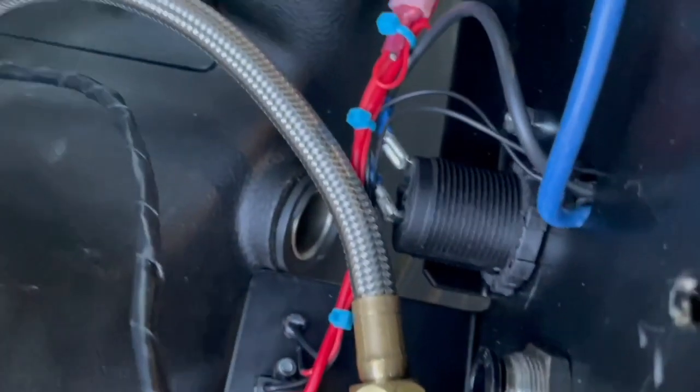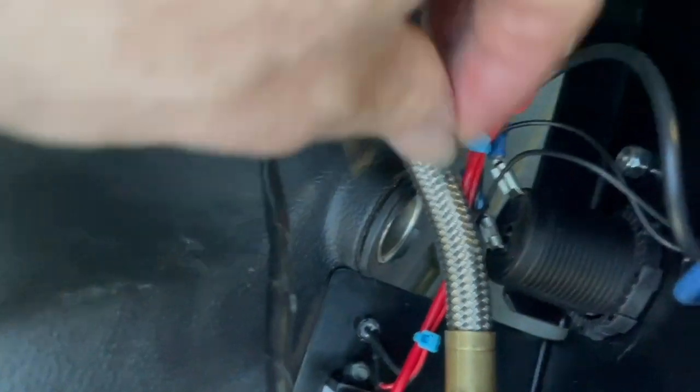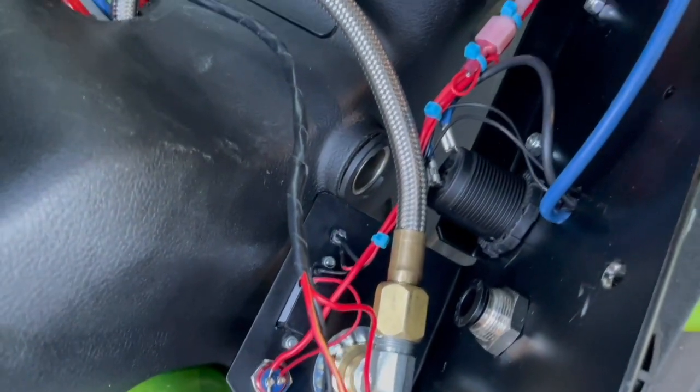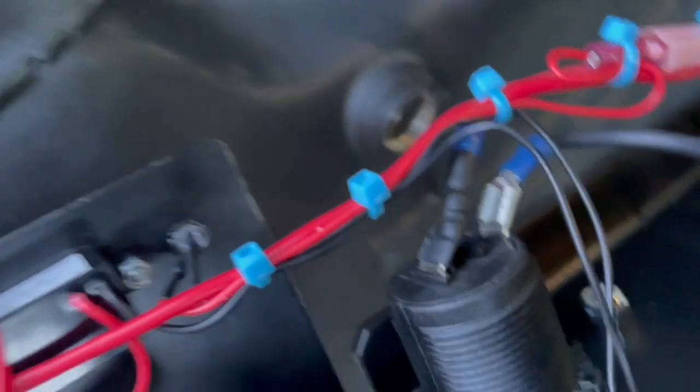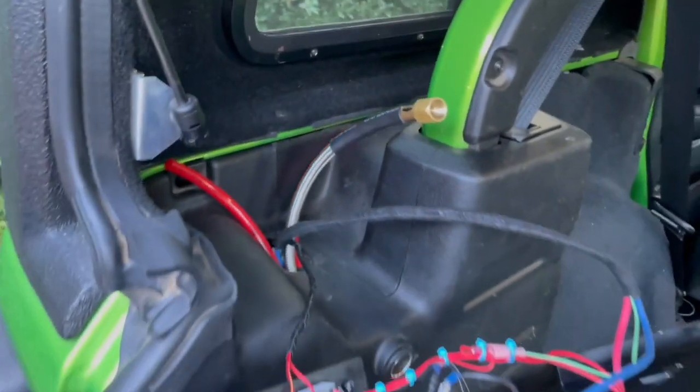So we just popped our first fuse just as I was going to put it back, because guess what we did? As I went to put that back, this metal touched those things there. So we're going to heat shrink this up to insulate it, and we're going to put some heat shrink on those 2 points there to prevent it from sparking off the 12 volts. And that's why you have fuses. That's why I got fuses. Yeah, buddy. To save future fuses, there's the hot for the 12 volt. It's covered. And we even gave a turtleneck to our nice little air hose.